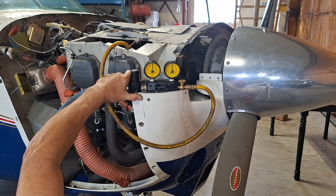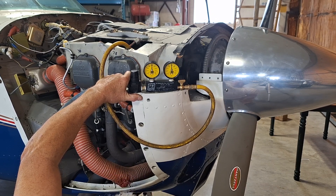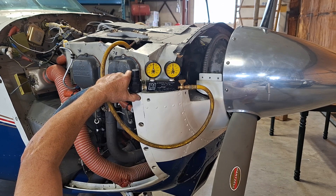60 is considered acceptable unless it's leaking out of the exhaust valve. If it's leaking even at 70 and it's leaking out of the exhaust valve, I usually correct the problem because it's just going to burn the exhaust valve out anyway.